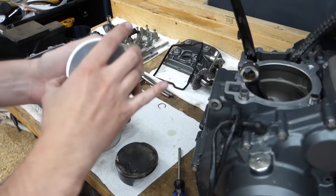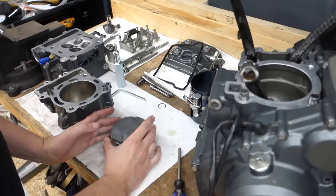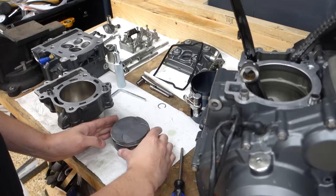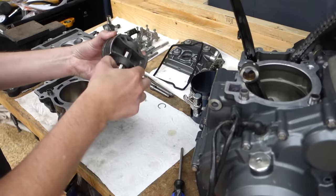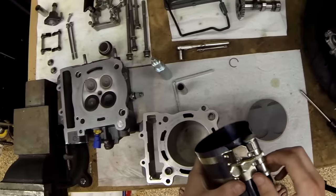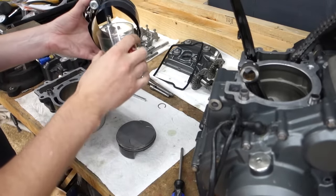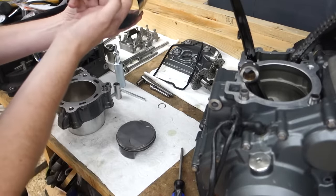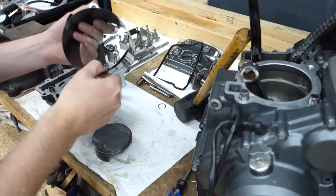I have to set the ring gaps at 120 degrees apart from each other. The rings already came pre-installed, which was kind of cool. With all these set in a compressible state - perfect, none of them are binding up. I need to pull out the wrist pin; don't need that in there right now. We're going to use this piston ring compressor that I got from Harbor Freight - honestly not the best but it'll do. We want to lube this up too so we have a nice frictionless surface as we try to get this into the cylinder.